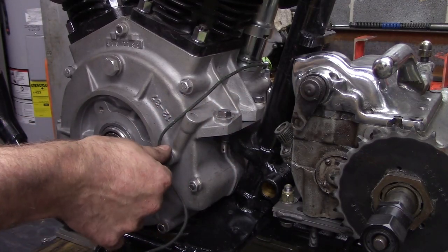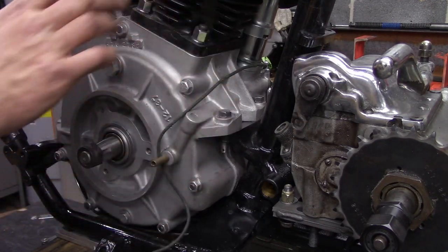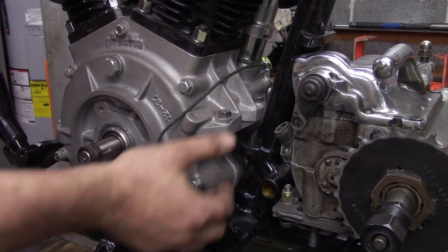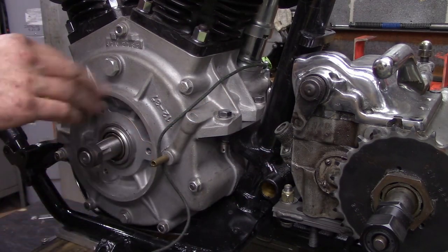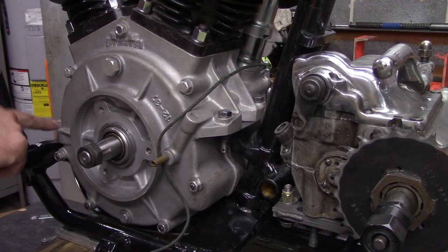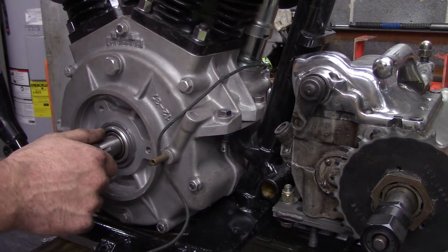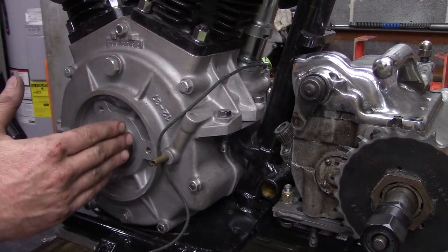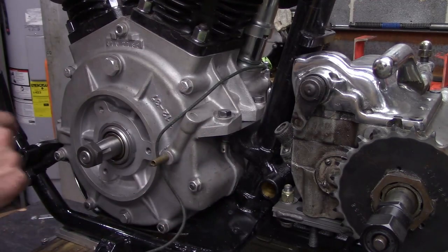The question is: do we shim it this way or this way? Generally when you're shimming a motor you'll snug down the back and then check the front with feeler gauges and shim the front. But I always like to check the angle of the motor compared to the rest of the driveline first.